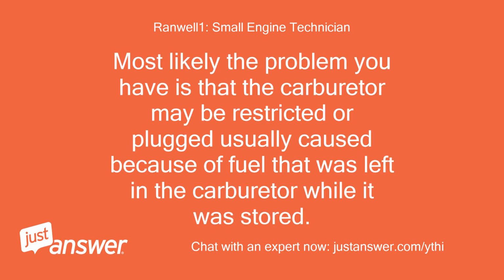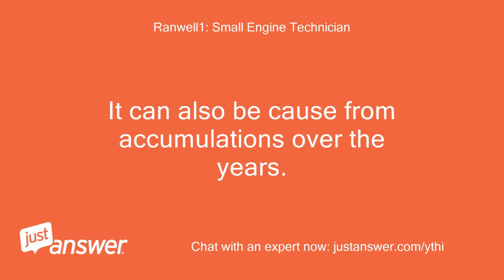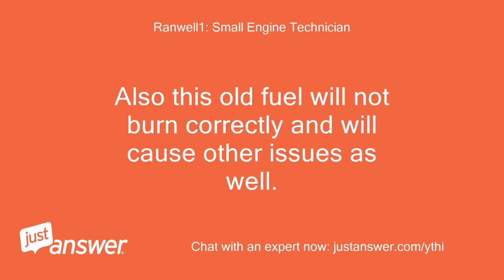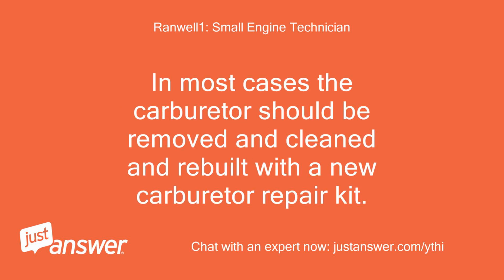Most likely the problem you have is that the carburetor may be restricted or plugged, usually caused because of fuel that was left in the carburetor while it was stored. It can also be caused from accumulations over the years. Fuel cannot be used if it is over 30 days old. Also, this old fuel will not burn correctly and will cause other issues as well. In most cases, the carburetor should be removed and cleaned and rebuilt with a new carburetor repair kit.